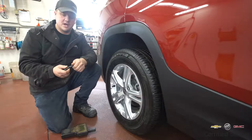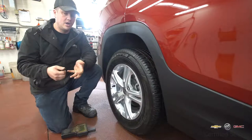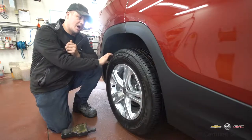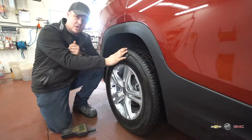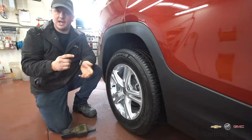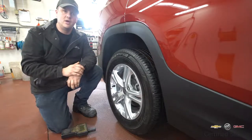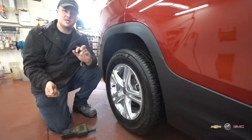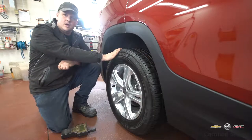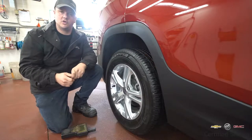They put these systems on for a couple of reasons. Obviously fuel mileage — a tire that's full of air will roll easier, so it helps your fuel mileage. It'll also help with your tire wear. If you have too little air pressure in your tires, you'll get wear on the outside edges; if you have too much, you can wear out the center. And obviously for braking and handling — tires that are low in air, or one that's low compared to another, can cause the car to pull one way or the other and handle differently. Realistically, this rubber is the only contact point with the road on your vehicle.